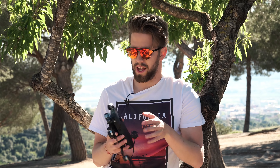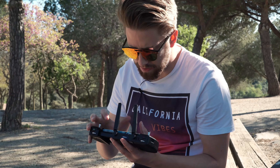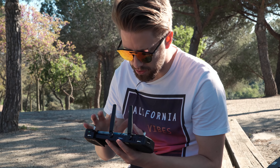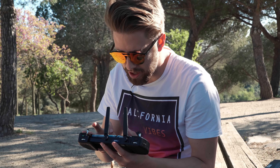You could see some of the footage that the GDU O2 was able to capture with its three-axis gimbal. I want to mention that you can't really adjust video settings while filming — you can adjust the EV, but you can't adjust the shutter speed or aperture. Everything is automatic. For resolution you can choose among three options: 4K 30fps, Full HD 30fps, and 720p 30fps. So Full HD 60fps is not available. Interestingly, you have three video modes: normal record, time lapse, and slow motion.